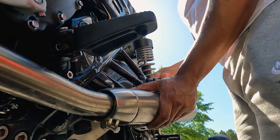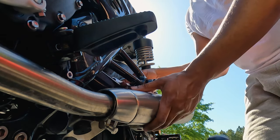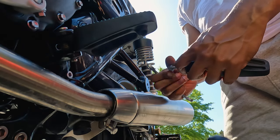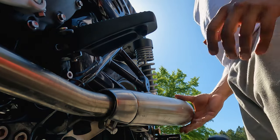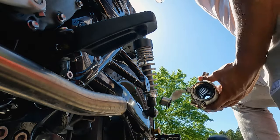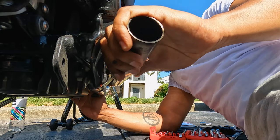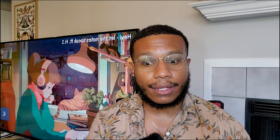If you've ever fitted an X-pipe on a Triumph Street Twin, it's really the same process — you're loosening up the frame on both sides. I needed to make sure it was stood up properly on paddock stands; if you're doing it on a side stand, it's going to be hell to get that off. You basically need to loosen everything from the header pipes and also take off the pipes in the back underneath. The heat guard I had to take out as well. At this point I realized I can't shimmy this off, because on Euro 5 bikes the pipes are also welded to the catalytic converter.